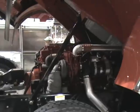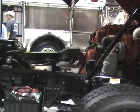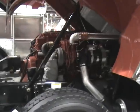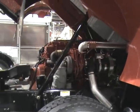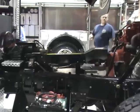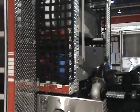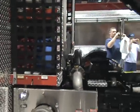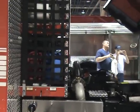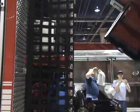This particular truck features an ISL Cummins engine along with an Allison transmission. The Cummins ISL is available up to 425 horsepower, and it's got an Allison 3000 series transmission. You see your side intake and discharge, as well as your very low crosslays — they're only a few inches above the frame. So you have two crosslays right above the frame and then a two-and-a-half above that.